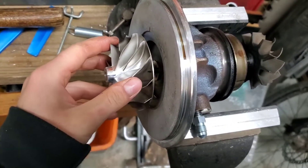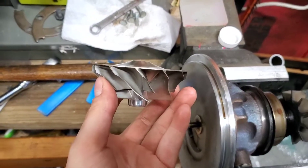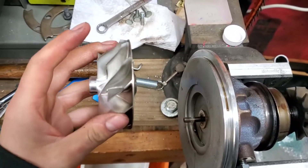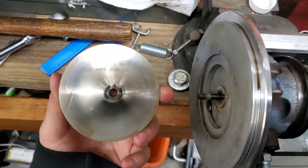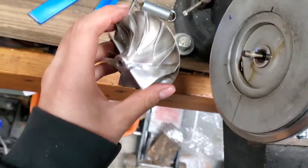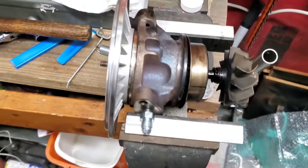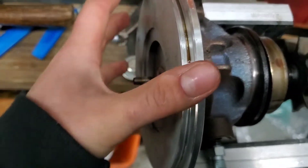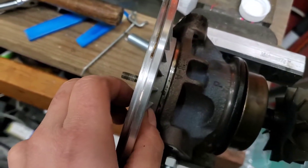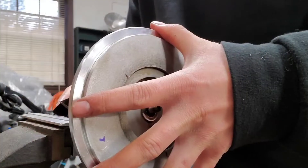As I'm pulling this off, you can see there's really no area to put a puller on this — so don't try to use any metal objects and pry from the side. You'll end up bending your compressor, and at that point you might as well just get a whole new turbo because you'd have to get compressor and turbine and balance them both together. Lightly tap the aluminum backing plate to separate it from the bearing housing. It's already loose enough, so gently slide this off.